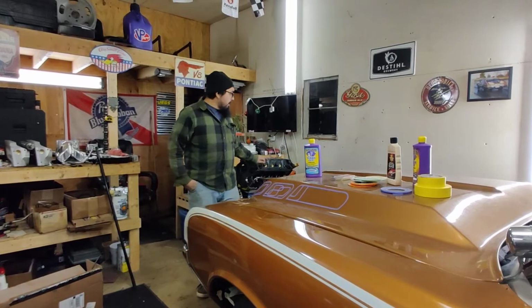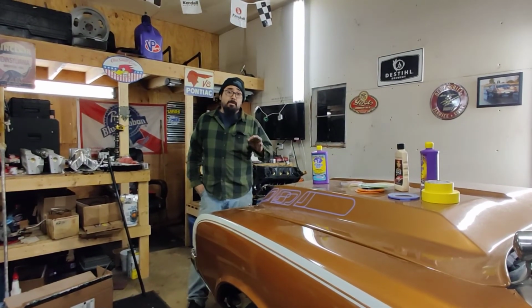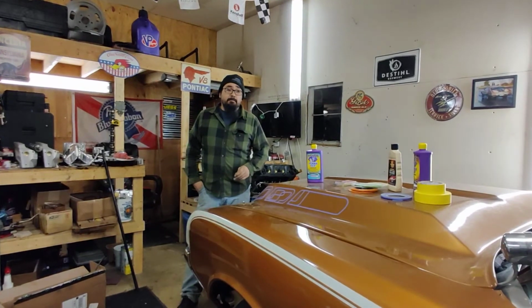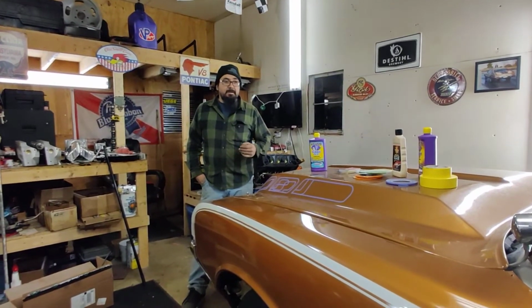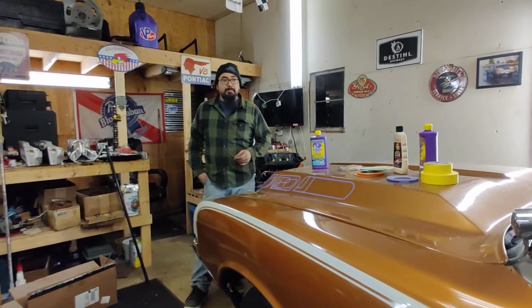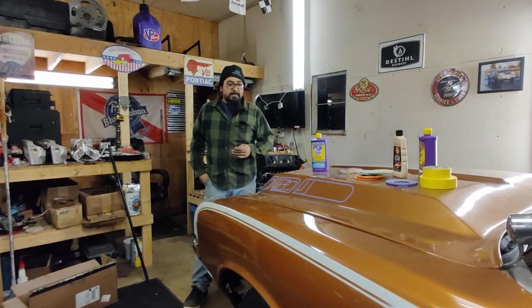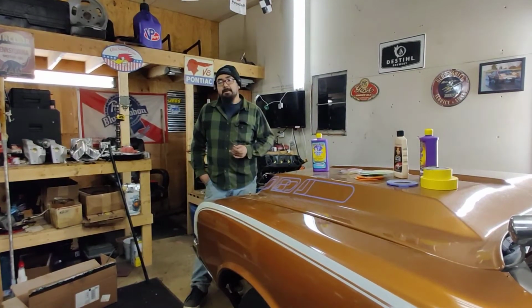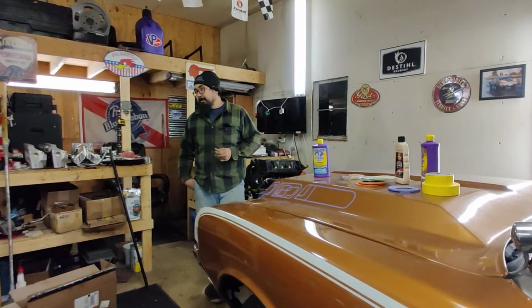And so the rods are good, just the main clearances are a little tight, so we're going to go with what has been suggested and what we thought in our minds, that we should be a little bit looser than that. So we're going to do that. And again, big thanks to JJ for chiming in on that. He watches the videos and he usually comments on something.